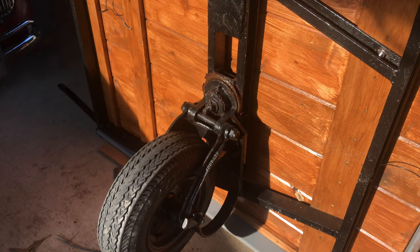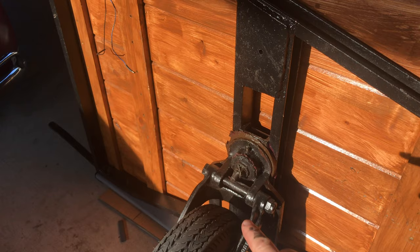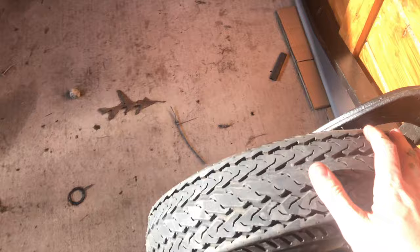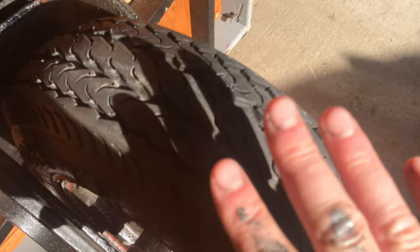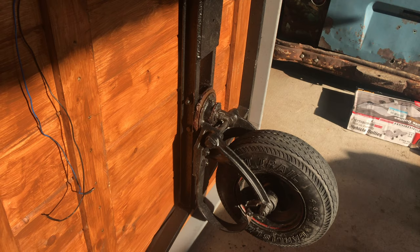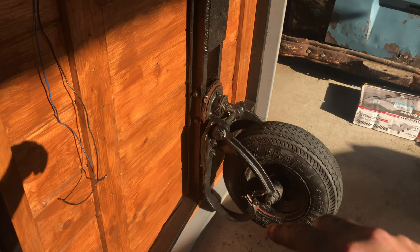I'm going to build a couple of felt washers the same diameter as that main spindle hub, coat them with bearing grease, and that should fix that issue. The wheel itself — I've taken all of the play out of it so it doesn't move side to side anymore, it spins free. You can actually see, though it's too much sun, it's kind of scored the center of this tire where it would hop on the road. That is the problem I believe. If it's not, we'll drop it back down and give it its original rake — about 13 to 14 degrees at normal height and about 17 degrees when slammed down on the air shocks.